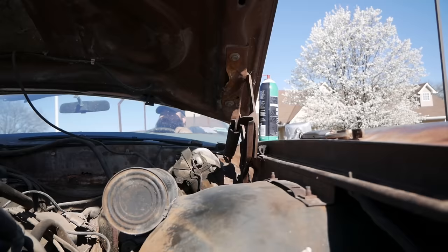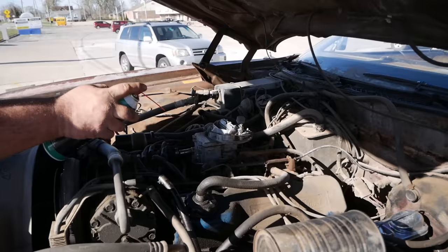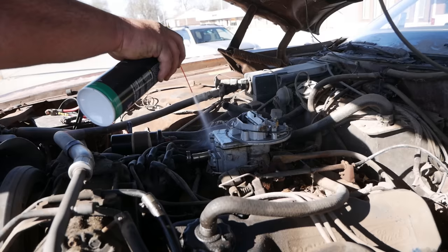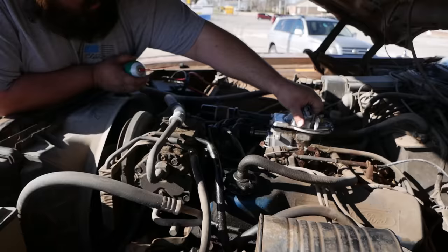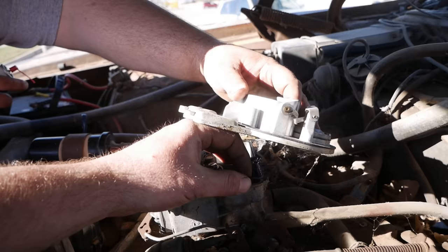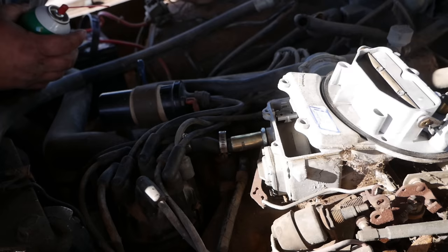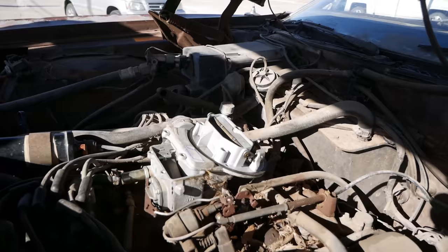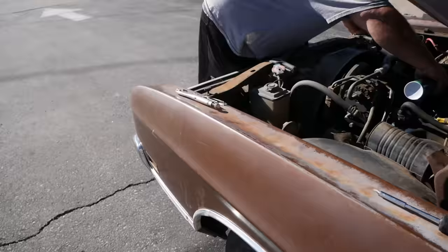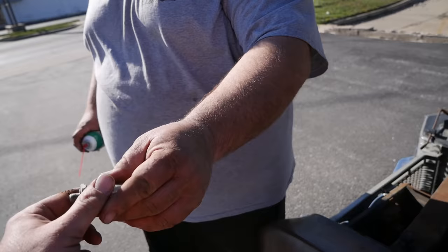It died again — we'll throw our spare battery in it and maybe that fixes it. Things have escalated. We got all the screws out — he's going to clean it off so we don't dump anything in there. Maybe soften up the gasket. The carburetor top just popped right off. You're still attached on the choke linkage but it should just swing over. Pull the float out — it is full of crap, empty of gas. We cranked on it, no fuel came into the bowl. The needle is moving so it's not that — it's the filter. She must have sucked up another load of varnish. That's all it was — just another load of crap out of that line.